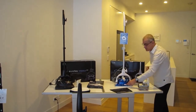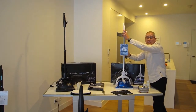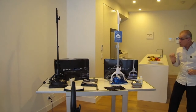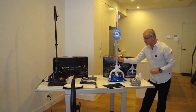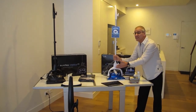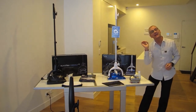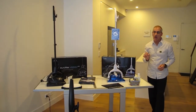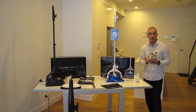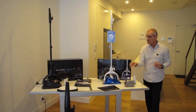If the 4 jets here at the front have stopped working, that usually means that the handle has slid down. Make sure the handle is fully extended and locked into place. Also, when that handle is assembled, the handle stays assembled. Some customers are removing the handle, they're yanking it out, damaging all the internal mechanism, and again, that's a user fault, it's not covered by warranty. And the last thing is that the green ready light will fluctuate on and off as the thermostats operate on and off.